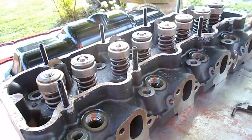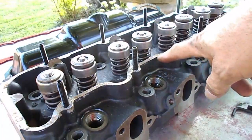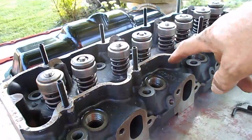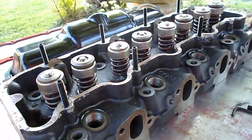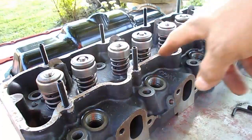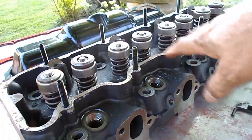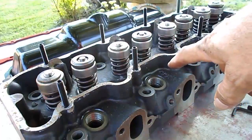Leroy Diesel again — I had a bright idea to throw this cylinder head up on the table and show you a little more detail. Let's pretend this is mounted on the block. You have your choice to put a gasket here for your seal on the valve cover or not — a lot of people will just use black RTV or the brand called the Right Stuff, and they'll squirt out a bead on either the valve cover or the head. You also need to make sure these surfaces are perfectly clean and free of oil.